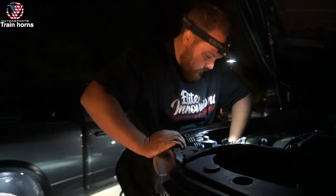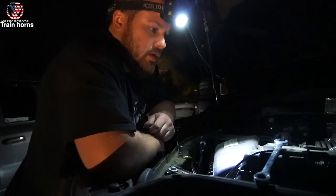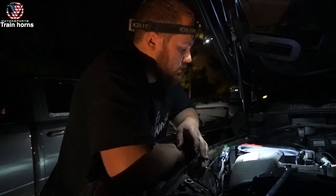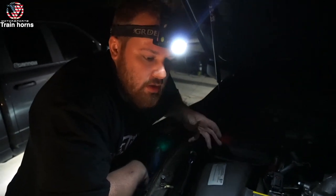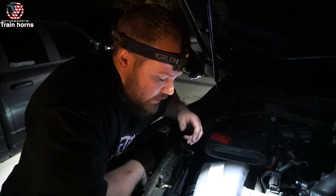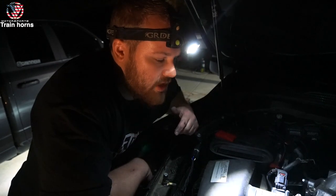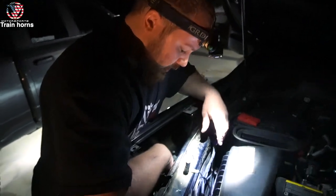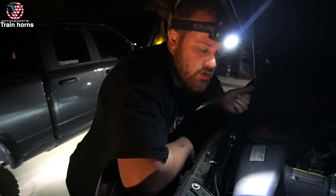A lot has happened since I went to eat. Before I left we had all the mechanical stuff pretty much done — tank mounted, compressor, horns, onboard air. Then all the electrical had to be done. A trigger from the ignition fuse runs to a relay, which sends power to the pressure switch. The pressure switch tells the compressor whether to cut on or stay off depending on tank pressure. To activate the train horn, instead of a secondary push button in the cab, you can use your factory horn — I unplugged the factory horn, tapped into that circuit, and sent power back to the solenoid, so pressing the center airbag sets off the train horn.